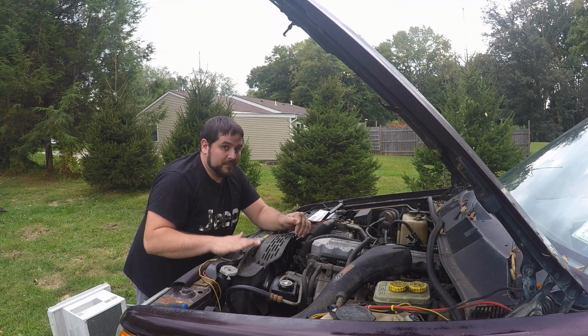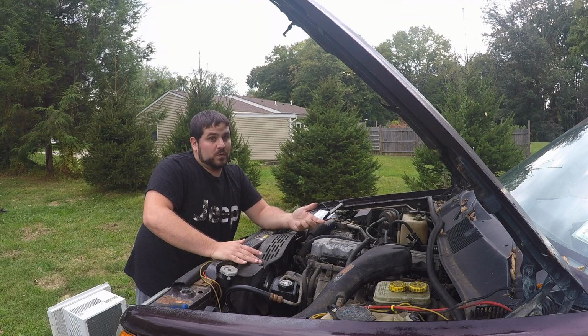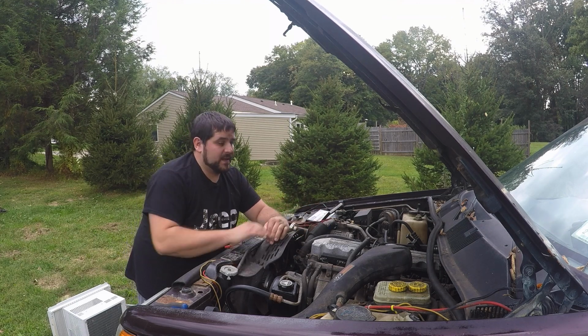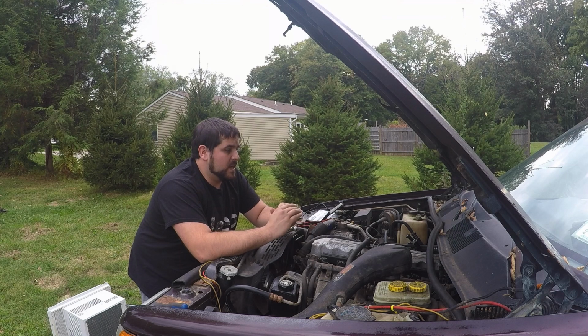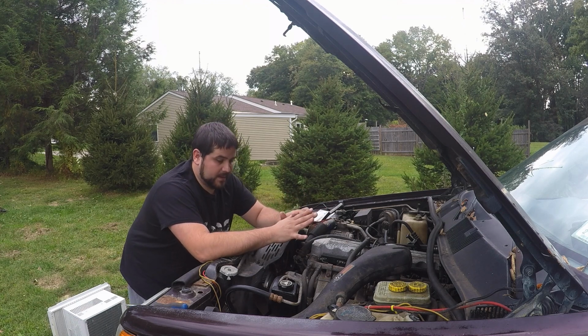The 2-row I got for the Jeep was the factory tow package one, which held more coolant and cooled things down quicker. I installed that, and beautiful, all my cooling problems went away. It's a nice, quick and easy upgrade you can do, and it dropped the temperature from about 210 to about the 190s, if people are asking. I loved it, and I had no problems after that, pretty much.